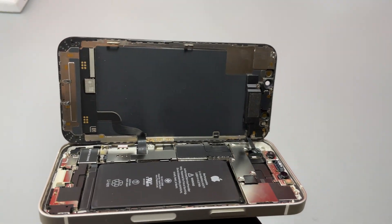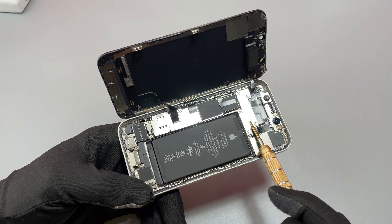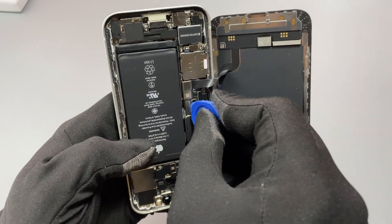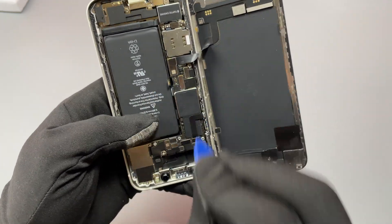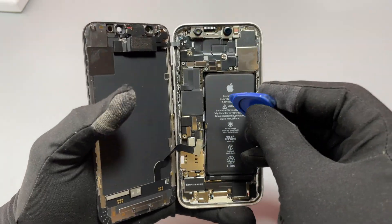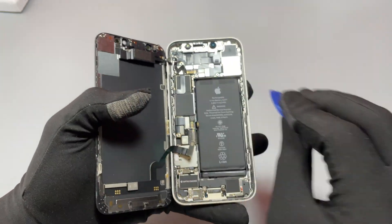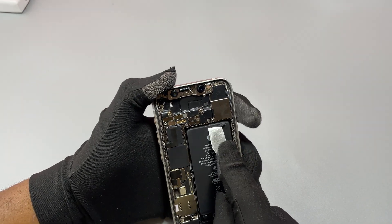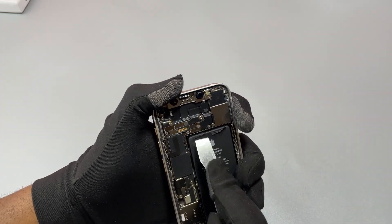To continue our battery replacement we need to remove six screws — five on the top near the cameras and one in the middle. Very important: use a plastic tool to always remove your battery cable. Do not use a metal tool — you risk creating fire and permanently damaging your device. For this repair we need to remove two flex cables: one on the top and the other one in the middle. Those are the flex cables for the screen.